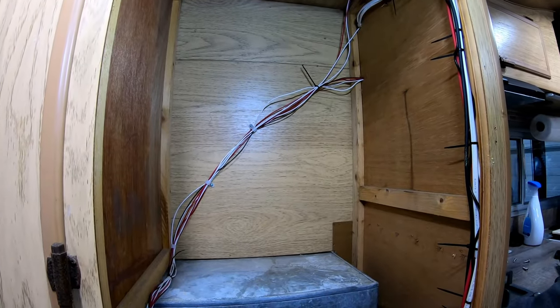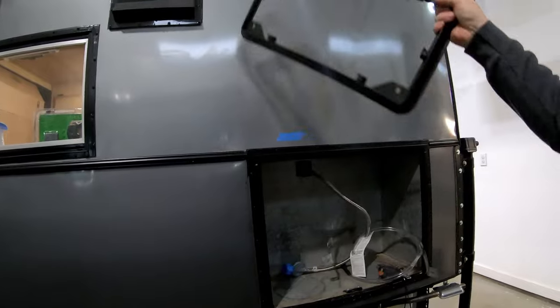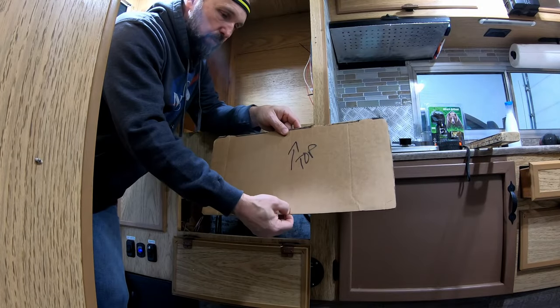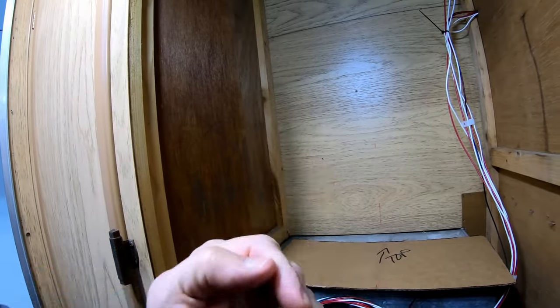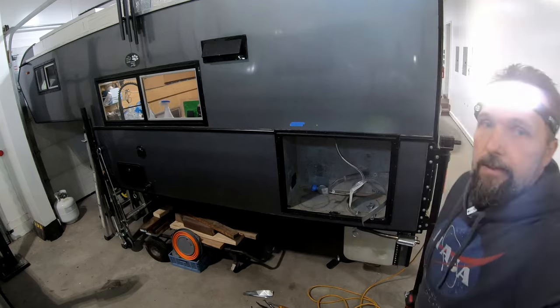Here's our raw cabinet. First off, my height is no good — I need to be 29 and a half inches, so I'm going to be cutting up here. Let me walk you through my logic as I prepare to cut a hole in a perfectly good camper. I have the Dometic vent template, my center point marked, and I'm going to drill a pilot hole through here to index me. That's going to be the bottom of this hole, and now I need to figure out the other corners.